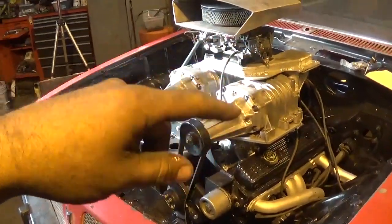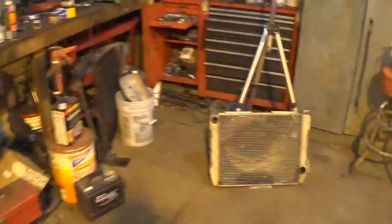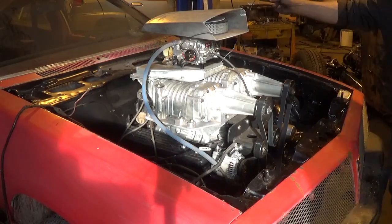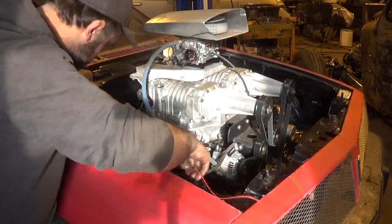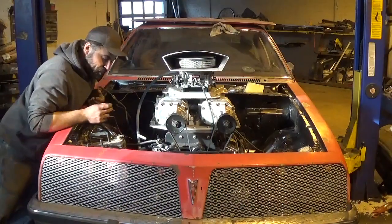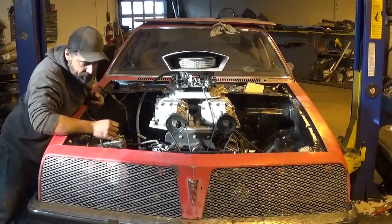I'm going to grab a few wires, get them hooked up to the distributor and the starter, see if this thing cranks over first of all, and let's put a little fuel and spark to it and see what happens. I'll get our little red solenoid wire down on that terminal and see if she cranks. I'm going to grab a battery here and get everything hooked up. The green wire is my HEI distributor, and the red one should roll it over. We'll roll it over first to make sure we got fuel to carb and see what happens. I'm going to give it a tap on the solenoid and see if it rolls over, see if the belt jumps off immediately or if it's actually going to stay on long enough to start it.